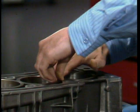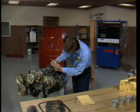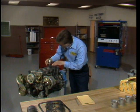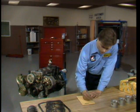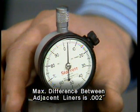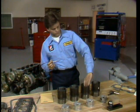Install the liners in the block. There are three separate measurement standards that the liners must meet. First, liner protrusion above the block must fall between the low and high spec as shown in the workshop manual. On a type J engine, it's 3 to 6 thousandths of an inch, or 0.08 to 0.15 millimeters. Using tools MOT251.01 and MOT252.01, you measure liner protrusion. Be sure to record all measurements. The second standard is that the maximum difference between any two adjacent liners cannot exceed specified limits — on our type J, it's 2 thousandths of an inch, or 0.05 millimeters. And third, the protrusion should be arranged to form a step sequence, so that the liners rise from one end of the block to the other. When all three criteria are met, remark them as to location in the block, starting with number 1 at the flywheel end.